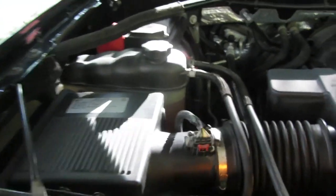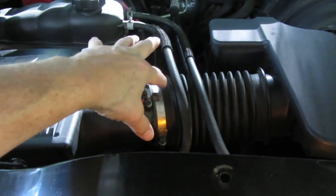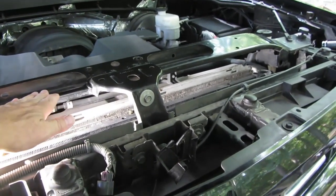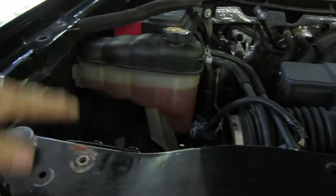We're also going to have to take out the air box, because it's just a whole lot easier to get to everything if you do. So we're going to take the air box out. I don't know if we're going to take all of it out or just the air box up to here — we'll find out when we get there. So let us continue. For this bar, you also have to undo the two little side supports.